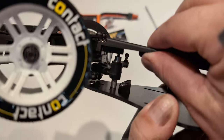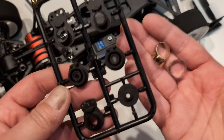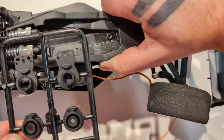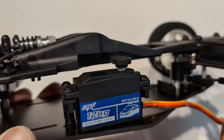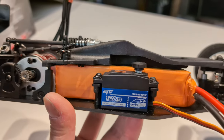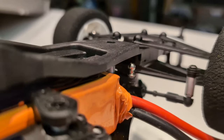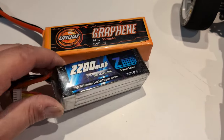My plan is to loosen the screws, lift up the top tray, and shim it so the battery will actually fit. The kit comes with a servo saver, but I want to live on the edge. The servo horn should be up and out of the way of the battery. Little tip: when setting up your servo, plug it into a power source and make sure it's set to zero before you put the servo horn on. I managed to squeeze it in with some minor modifications — but now the servo can't servo. I don't even know how I'd get the steering linkage to work there.